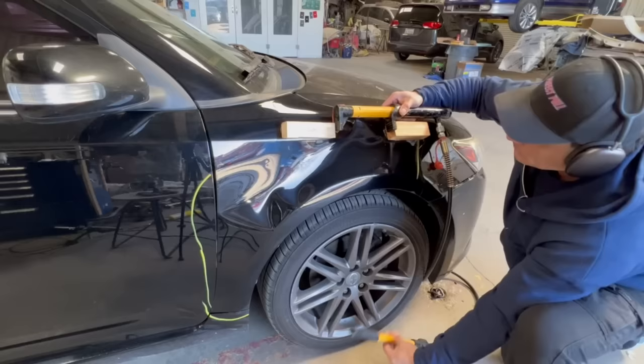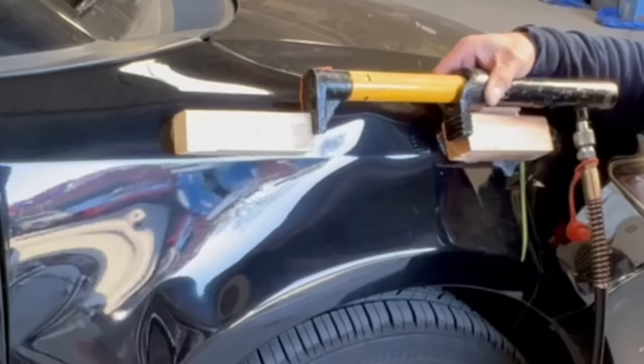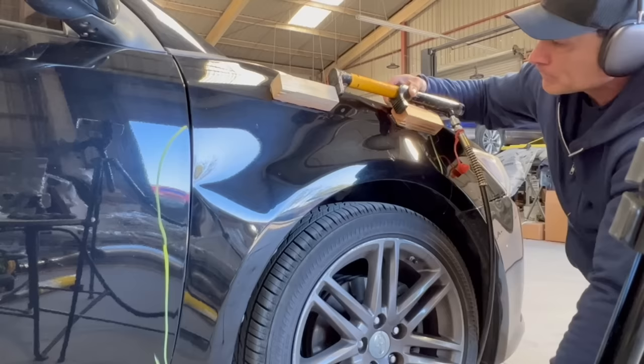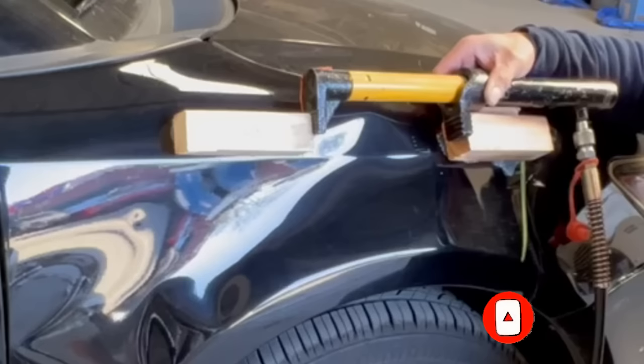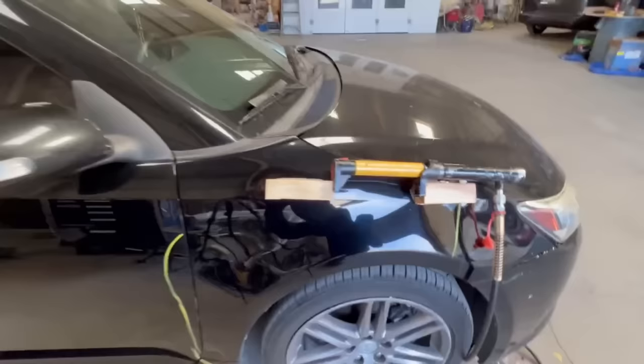The toughest part of the dent is coming out perfectly — no pushing, no knocking down on the crown. The Porta Power did most of the work. Now that's what I'm talking about — making my life easier when pulling dents. Did you see the flex in that panel? Let's take a look at that one more time. That was awesome — the two blocks of wood stretching out the dent, and you can see the crown and the bottom of that dent move.